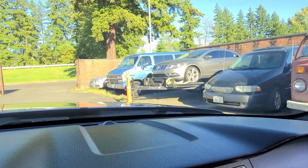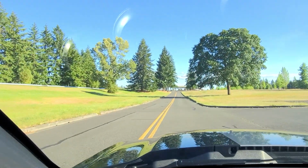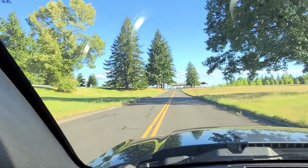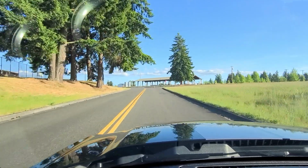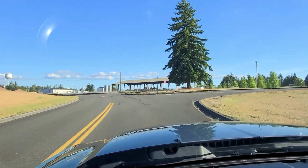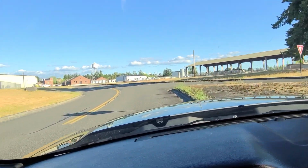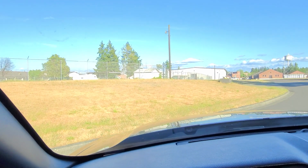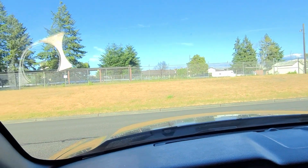Alright, I'm just taking it out for a little test drive here around the block just to see how it engages and disengages. Definitely engages a lot higher than stock. Well, not a lot higher. But it definitely engages a little stiffer. I guess it's more like the 13, 14 clutches in these things than the factory 11 and 12s that are in this. Just back this bitch up. Good though.